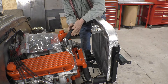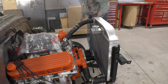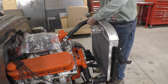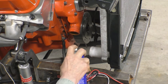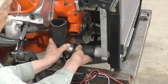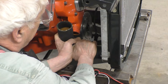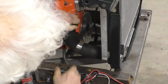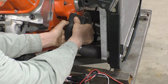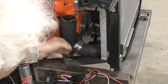There's a kink in the upper hose, but I think for what we're going to do this will work. The bottom hose is going to take a little bit of change — if we put it on like so, it is way too long when you want to go to the water pump. It's almost two inches too long, so we're going to have to cut it.